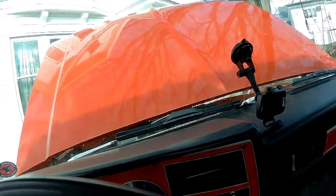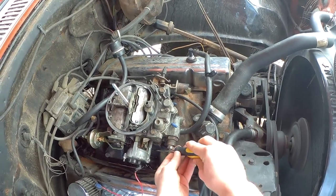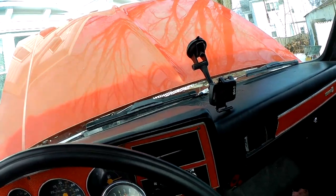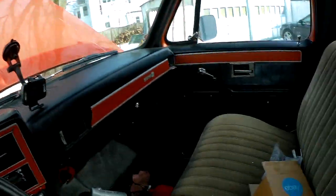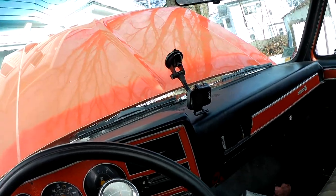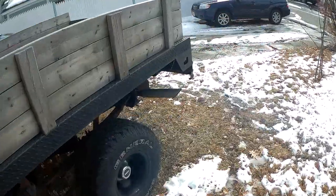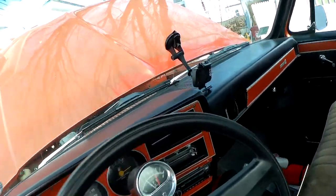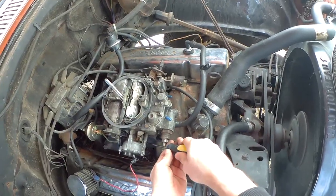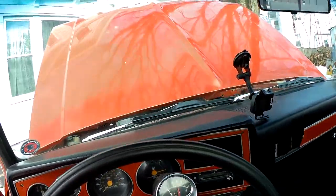Surging like a motherfucker — 3000 RPM, that's crazy. I don't know — 2400, is that too much? I should probably look this up in a manual. That also seems high, so I'm going to taper it down further — say 2000. We're still smoking but not nearly as bad. That RPM went up again. Still seems fast as hell, and my concern right now is that the choke isn't advancing at all.